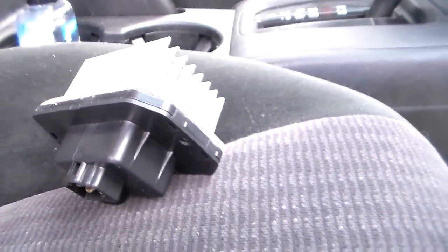One other reason is behind this glove box. You take the glove box, release the little latch and squeeze the sides, and the cabin air filter is behind this in a tray that slides out. That thing gets plugged up and restricts the airflow, so the resistor runs too hot and finally burns up.